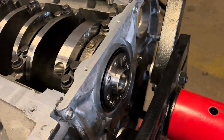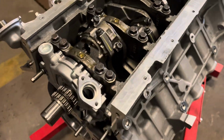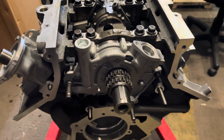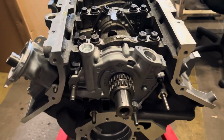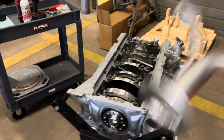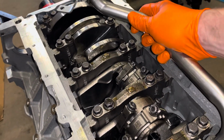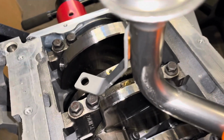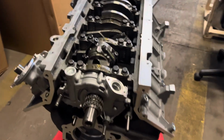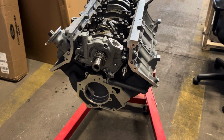All right, kind of skipped and cruising right along here. Got the Gen 1-2 rear plate on, rear main seal all back on the Gen 3 block, and now the oil pump assembly and crankshaft sprocket are replaced with a Gen 2 type unit and a Gen 1 crank sprocket. Little thing I didn't account for in my parts acquisition was the main stud you need to support the pickup tube. So I'll have to get that, because like I said, the Gen 3 oil pan has the pickup tube and all that at once, so that stud isn't really needed. But I'm gonna continue cruising while I source that bolt and nut, and because I do have the pan in the box there, might even think about heads on next.